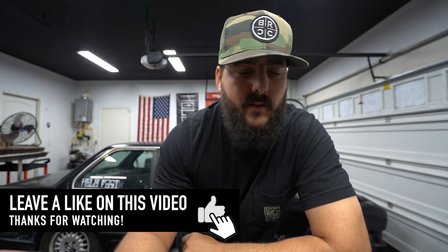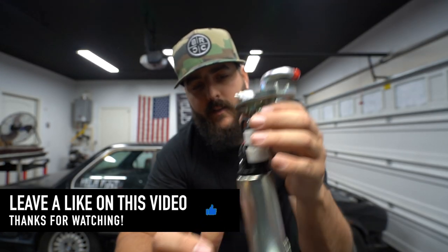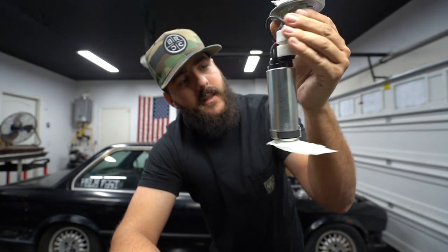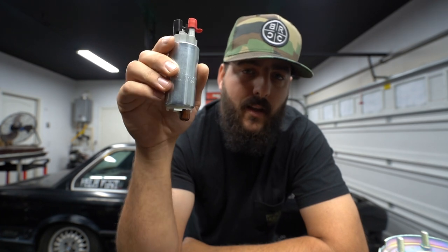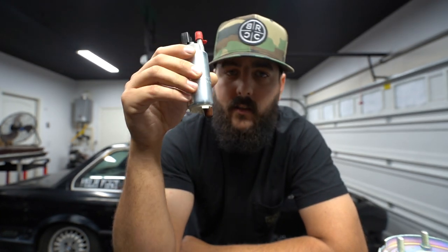I'll put the link to the new fuel pump hanger that I also bought in the Amazon store. The tank was about $250, and the sending unit or new hanger setup is all linked below or linked to my Amazon store — you can find it on my Instagram profile and the link in my bio. Some of you guys are on a budget like I am. This new hanger has a factory-specced pump on it and it's not good enough, so we reached out to our boys over at Radium and they blessed us with a 255 Walbro pump. This is going to deliver and maintain the right fuel amount and fuel pressure that we need to keep the beams happy.